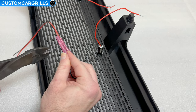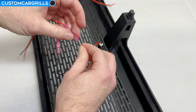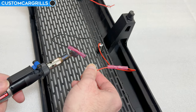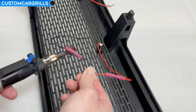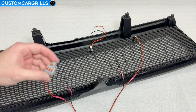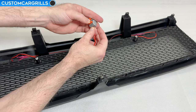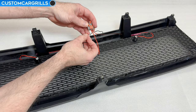Obviously, we're going to connect the black wire extension to the black wire on the light, and connect the red wire extension to the red wire on the light. While the crimped connection is generally going to be pretty solid, let's go ahead and finish this step by activating the heat shrink. I'm going to use a small butane torch here, but a good heat gun is probably a better tool to use for the job. The wires are now sealed, and it's time to combine all of the wires. I like using a little wire block that you can find online, which is designed for just this type of thing. On the end with three connections, I'll open those up and feed one red wire per hole, and then close the connections. Then let's repeat that for the black wires on the second wire block.